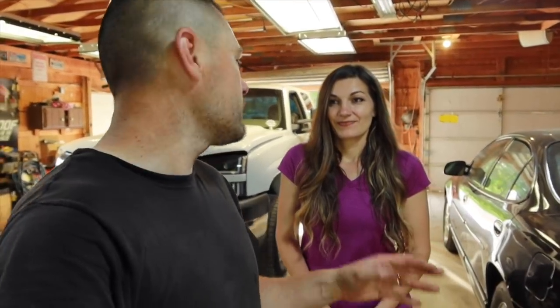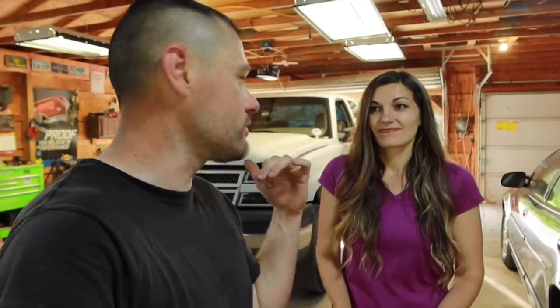A buddy of mine, Jalen, he actually has an LB7. I gave him a call and he was like, dude, it took me like six hours — you have to use the fan belt puller and all these little tricks. He actually broke the stud off the back of the turbo. It was just a bad deal. The good thing is we had this entire engine removed — Kodiak Truck guys installed the transmission as well as Ryan's shop. We put the engine in there and I went ahead and left some of those bolts back there loose, so it's a lot easier.